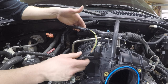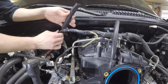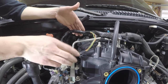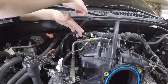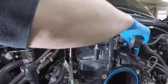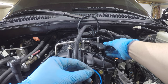Here is the rear MAP sensor — it has a green, gray, and orange wire coming out of the main harness on the passenger side. Normally the MAP sensor sits way in the back, so we removed the wire protector, carefully cut back the electrical tape, and peeled the wires back about halfway. Be very careful not to nick any wires when cutting. We re-routed the wires out and will coat them with electrical tape and a small wire sheath so they reach the MAP sensor on the front of the intake without needing to cut and extend any wires.